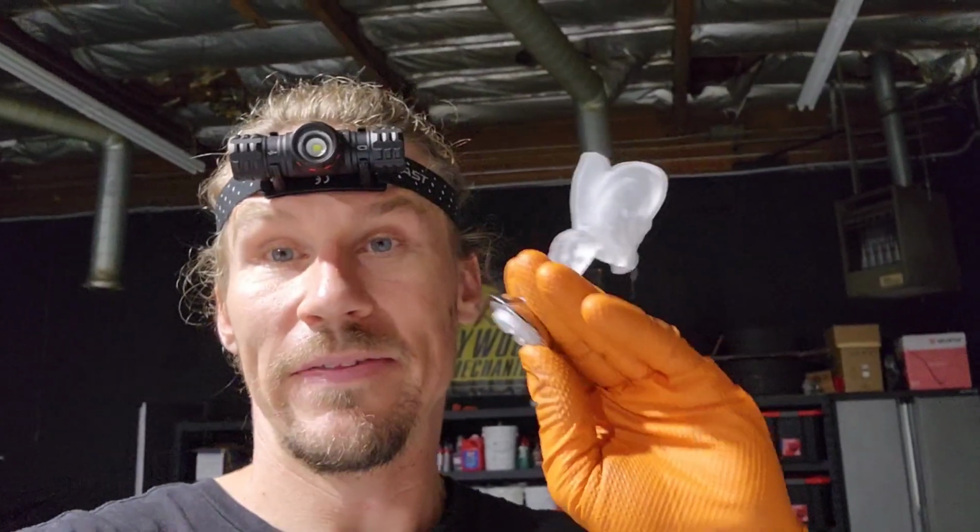And then you need to take your Spirit of Ecstasy off. To take this off, it is like a T that goes up inside of there, but there is a little locking pin. If you look at the back of the Spirit of Ecstasy, when you have the trim off, you'll see a little hole with a little metal tab inside, and you need to press that inward and downward, and that will unlock the Spirit of Ecstasy, and it should be able to rotate off either direction, actually, clockwise or counterclockwise.